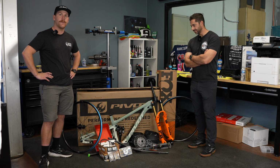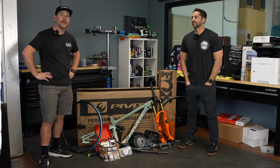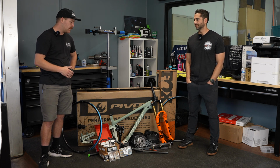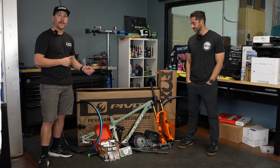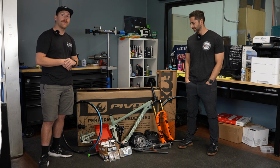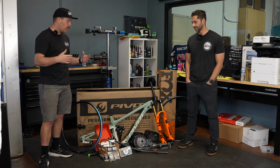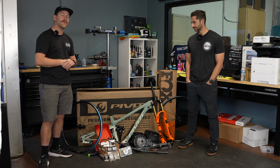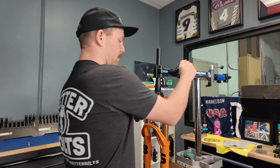We're gonna break this up into a few different episodes. So definitely hit the reminder to make sure that you come back to view more of these build videos. We're gonna start by getting this into a rolling chassis. So we're gonna get the tires mounted, wheels installed. We're gonna have to do a little bit of work on this fork. This right now is sitting at 160 and we have a 150 air spring for it. So we're gonna have to choke down that fork. We'll take you along for that. And then we'll wrap this video up and we'll catch you guys on the next one where we get the whole drivetrain installed and get the bike a lot more rideable. Let's get started with getting the rolling chassis going.